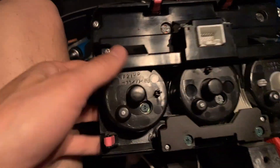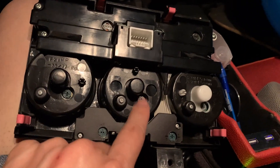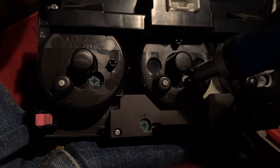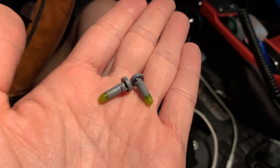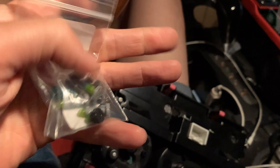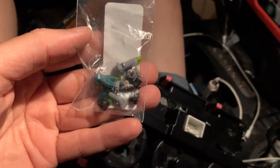The middle ones are what I'm focusing on. Out of the instrument cluster, this bulb right here is the one I'm trying to get into. Using just a flathead screwdriver, take it right there and unscrew it — it should pop right out. These are the old bulbs I just took out. In this packet of bulbs, it looks like these ones with the green tips — I need two of those to replace them.